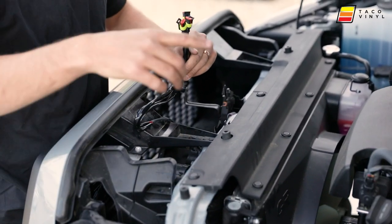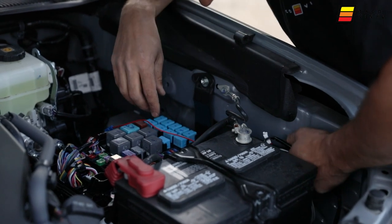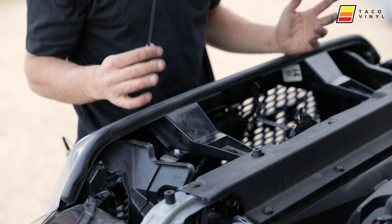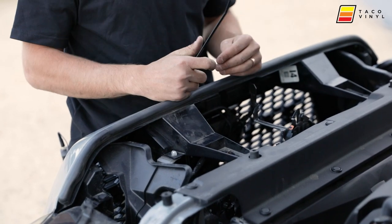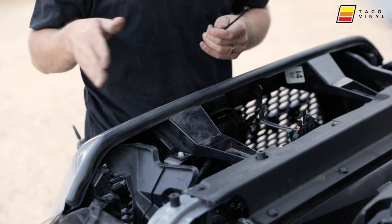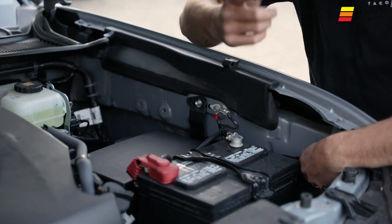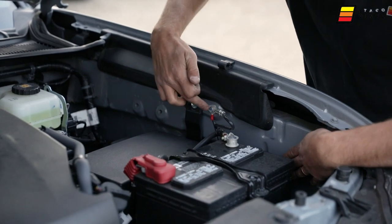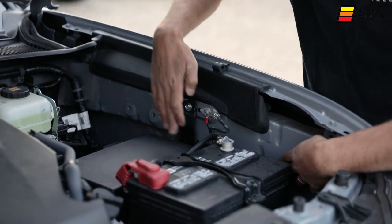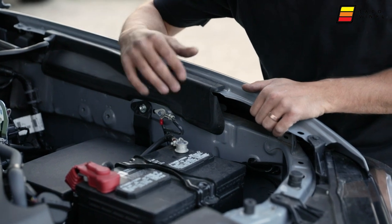To install the Raptor lights, route the wires in front of the directional plastic piece and then behind the headlight to the side of the battery near the fuse panel — just one wire per light. For cleanliness, make sure to zip tie the wires; there are holes along the top of the grille piece to thread zip ties through and tighten the wires upward. I harnessed the wire onto the hood-pop wire covering so it's out of the way, grounded it at the battery, and the positive is on the add-a-fuse. The lights will be on when the car is on and turn off with the car.